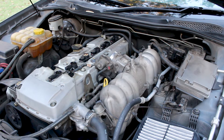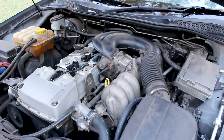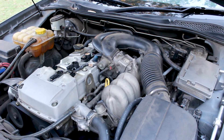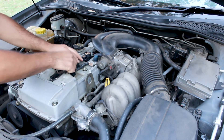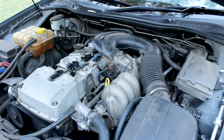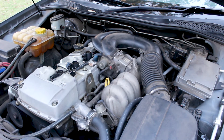So I wanted to simulate what a misfire would be like in a car like this, so I'll just go and start it up now. At the moment we're running smoothly with six cylinders firing as they should be. Now if I go in and disconnect one of the ignition coils that will cause a misfire — so we'll be running on five cylinders and you'll notice the difference in the engine. As you can see it's starting to run rough. If you're inside trying to drive that around it would be a very rough ride — you'd be low on power. If I knock out another cylinder... now it's getting particularly rough, so it wouldn't be a pleasant drive at all. You know you've got a problem and you've got to go to the mechanic and get it checked out.